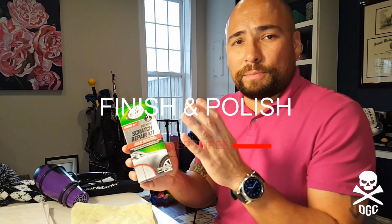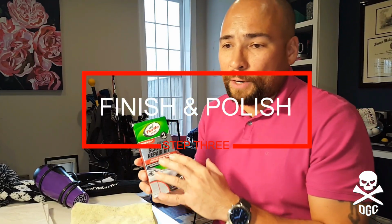And then step 3 is finish and polish. Finish and polish is going to be done with the polishing compound in here. You could hit it with some clear coat if you want to. I don't want to go that far, so I'm just going to hit it with the polishing compound, which allows you to get a nice shine or a gloss on your paint surface.